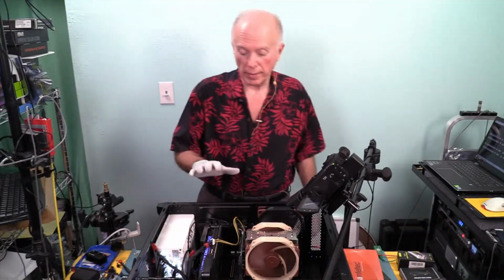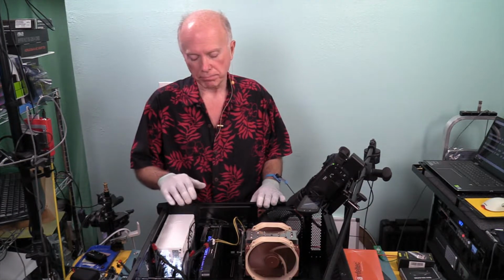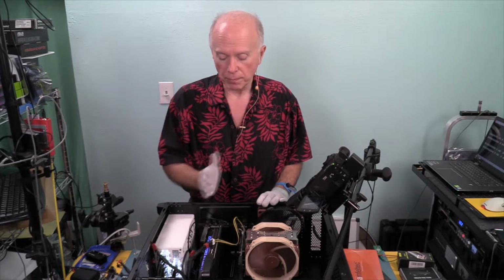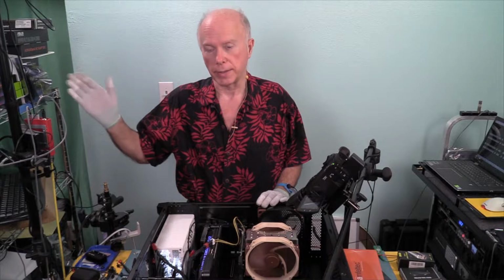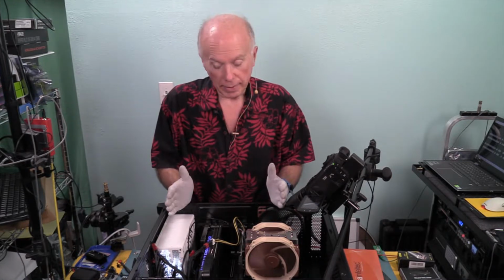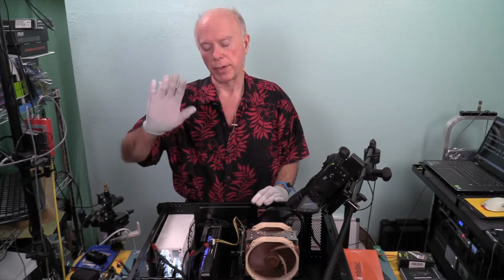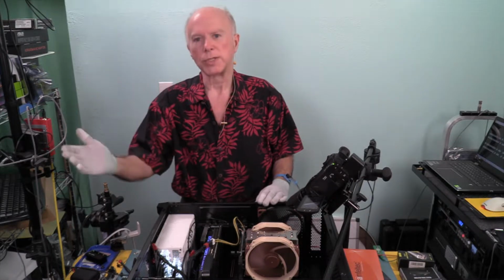Okay, so I've gone through quite a bit of an explanation. I want to show you those lights because right now, where we're at, how the drives are configured. Okay, the one on the motherboard's gone now. Everything now is on RAID. So I've taken the liberty of configuring the RAID in the BIOS, installing Windows on the RAID, and I'm ready to test. But before I test, so that it makes sense, I need to go back into the BIOS, show you how the RAID's configured, because remember, it's a difference in having 16 lane versus 8 lanes. And again, to reiterate, what I have done is not what I recommend, but I want to show you what I've done. We'll see how it affects it.